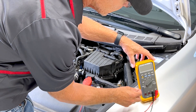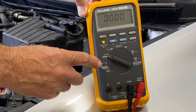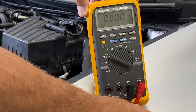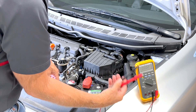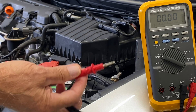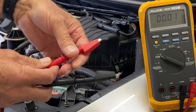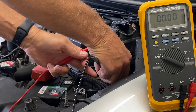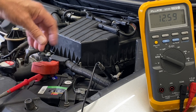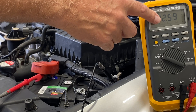To check the battery, all you have to do is put the meter on the voltage scale. Voltage DC looks like this — if it's AC, it's got that squiggly line, but DC is where you want to be. You want the black lead in the common port and the red lead in the voltage port. These meter leads are actually pretty nice — they unscrew and you can use them as a regular lead or as an alligator clip. I'll put a link to these in the description. Take the black lead, put it on the negative side, the red lead on the positive side, and just read the voltage. 12.6 volts is a fully charged battery, and that's right about where we are — 12.6 volts.